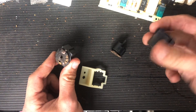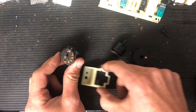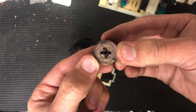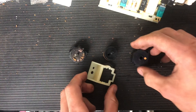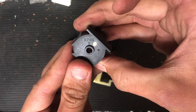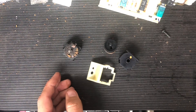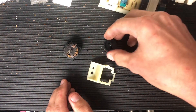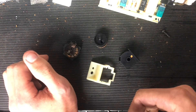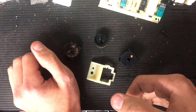What I'm going to end up doing is tapping in and adding relays for the three resistive speeds, because I really don't want to have to do this again. This is kind of a fire hazard, so I just wanted to share that with you. From my preliminary research, I typed in a GM 92100 switch on Google and a few results came up on eBay — I think they were under 10 bucks. I'll be replacing this and adding relays, and probably won't run into this issue again. And maybe my truck won't burn down.